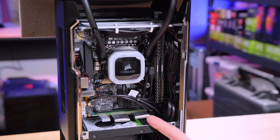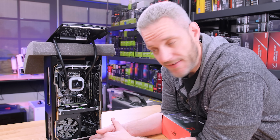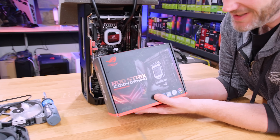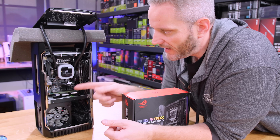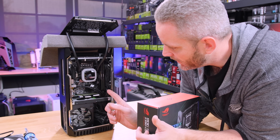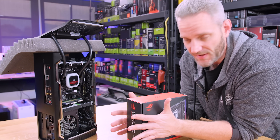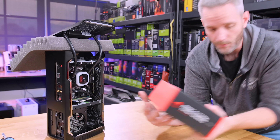The motherboard is nothing proprietary — it's a Z370, not a Z390. We talked about this in our review; they kind of cheaped out and didn't go with the full chipset feature set you'd want with the 9900K 9th Gen i9. If you wanted to change it out, you could — it's fully serviceable, nothing custom at all. I even brought in my ROG Strix Z390i Gaming box, which in my opinion is the motherboard they should have used. The concern with a chassis like this is the ITX layout — you'd have to make sure where the USB 3.0 lands, where the power plug lands, because the routing is very specific. I can't imagine there being enough cost difference at $3,600 for this thing for the better board not to have made sense.